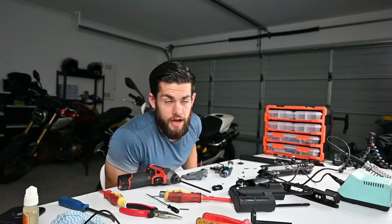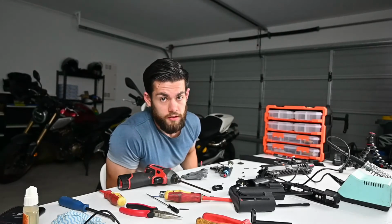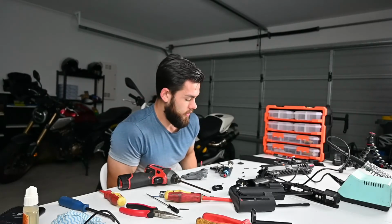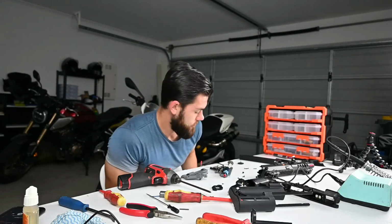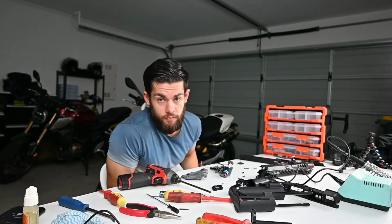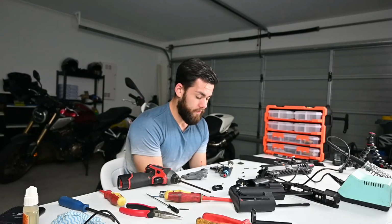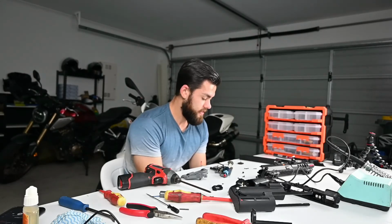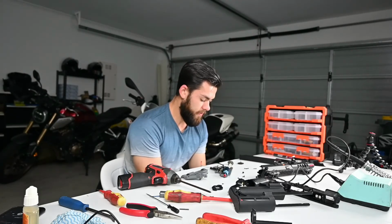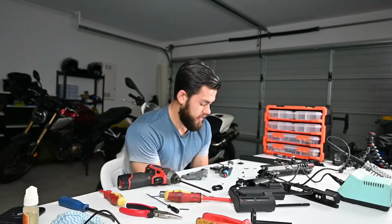Okay, so basically what happened is that as soon as it fired, the bushes pulled out of the gearbox shell. So the gear's unlocated. So I am gonna have to do exactly what he did and shim them on the top just to fill the space. Which is a bit dodgy in my opinion, but if your bushes are pulling out like that, it's not going to work. So just do what you got to do, get it to work, and then we're good to go.